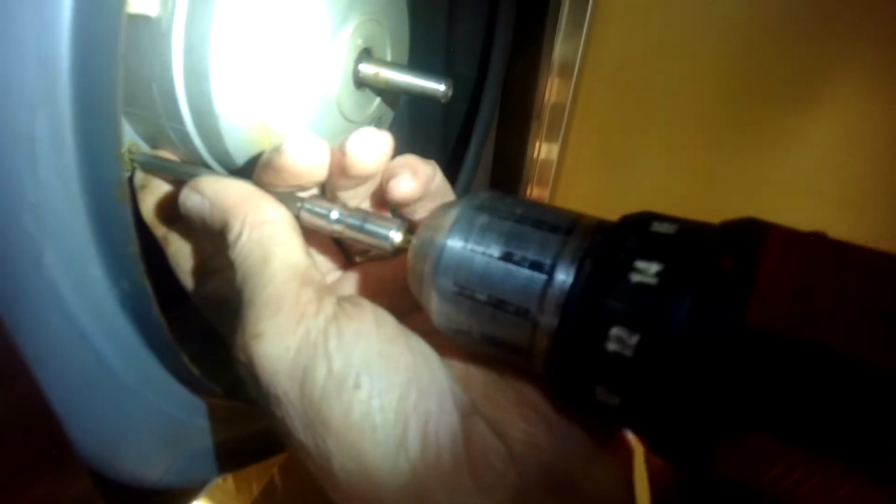You could also turn it on and just listen to it and see if you're getting the grinding sound from that motor. In this case, it was pretty clear that was the troublemaker. It even looked a little rusted up there. There's actually 2 bearings on the motor, one down where my fingers are, and then one higher up at the top of the motor. So I'm going to pull the motor out.